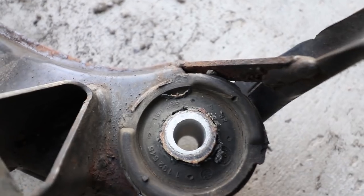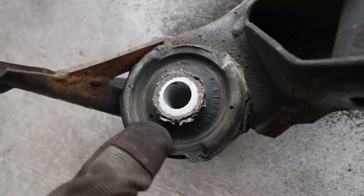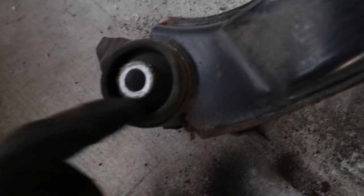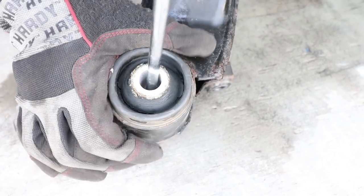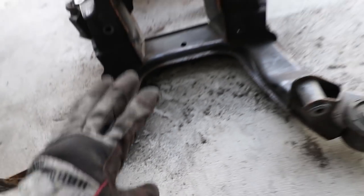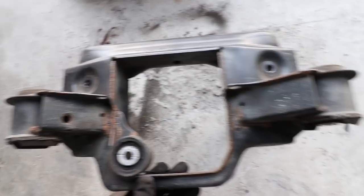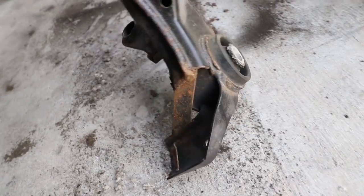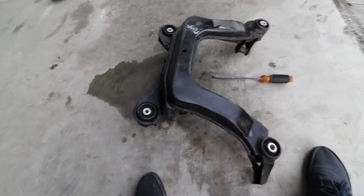Okay, time for a little update. You can see a lot better in here — see all those cracks and stuff around the edges? Same thing on that bushing there. These bushings are old, they're pretty messed up, and they're flaking off into pieces. This one's almost torn out — this is a lot worse than I thought it was going to be. Now for the rust — there's actually a lot more of it than I expected. It's all pretty much around the edges and none of it is deep, basically just surface rust. It's especially bad around this casing. I'm going to get a wire wheel with the drill and really clean this off after we burn these bushings out. I noticed I kind of already have reinforcement plates welded on here, but they're not very big and I don't feel they're that strong, so I'm going to cut those off and put on the AKG ones.